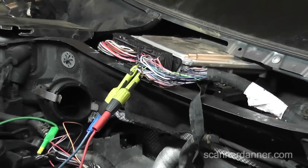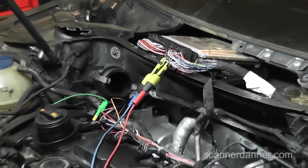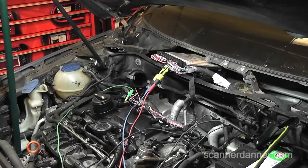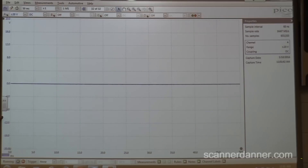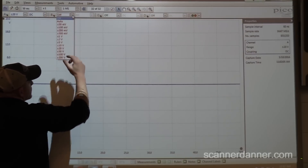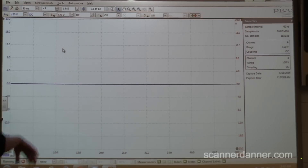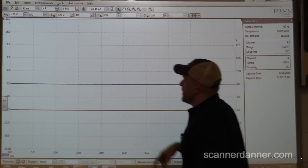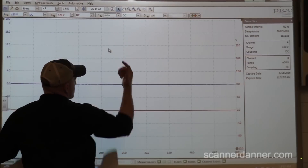Those two channels we'll look at, and the green one on the left at the bottom is going to my coil control signal. Let's get this pulled up on screen. Blue trace is my crank, and I believe it's an AC sine wave, so I like to leave my zero point in the middle of the screen for those kinds of sensors. I'll set it to 20 volts — VRS sensors can go as high as 50 volts, but not at low-speed cranking. Channel two is the cam; it should be a square wave. My third channel is the coil control signal, also set to 20 volts.